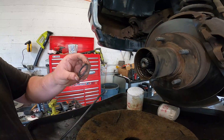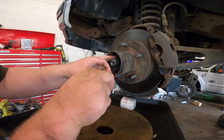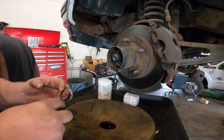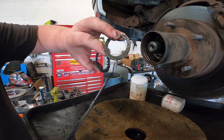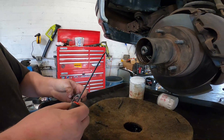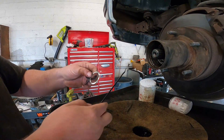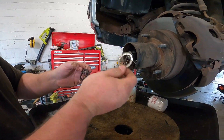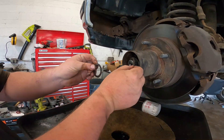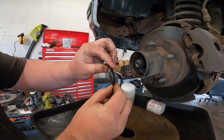This is your steel ring. And then behind it you'll have this kind of plastic, felt-feeling ring — that's just so it can get grip. And then behind it is this nice aluminum — or it might be steel — very skinny one. So when you're reassembling your rings, you go the aluminum one first, then your plastic one, and then the one with the teeth grooves. Push that one all the way back, and that's your full assembly right there.